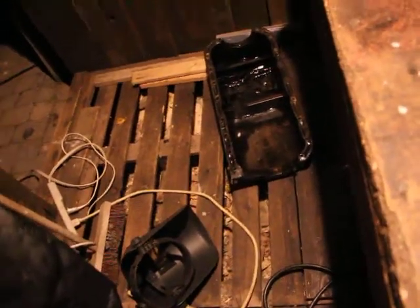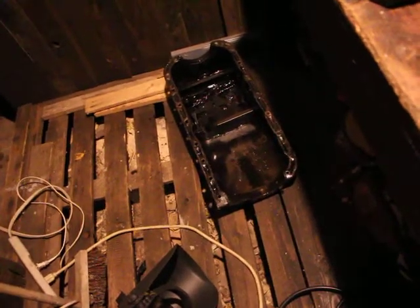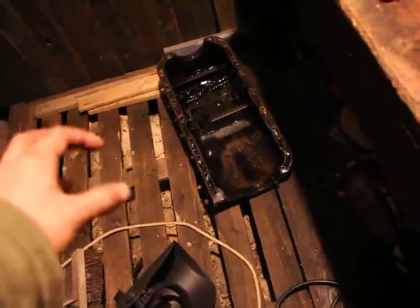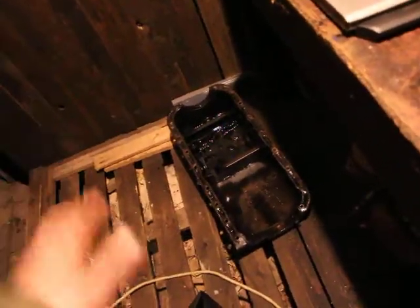I've used the blue RTV gasket for the cylinder head. It's worked fine for now. Until now, no problems at all. It looks pretty solid. But for this here, it's got to be a special gasket that resists the oil, right? You'll have to clean the old gasket out and make sure the steel is nice and dry and free of dirt and shit, right? Otherwise, you will get a leak there.